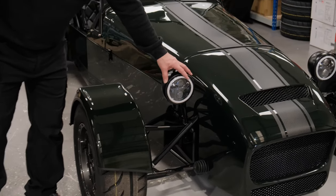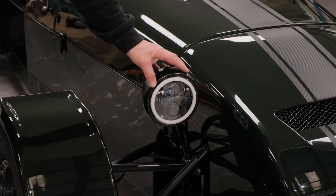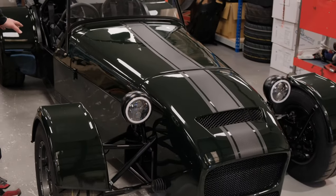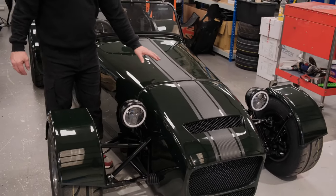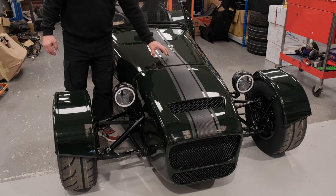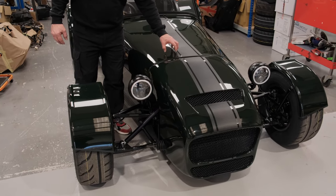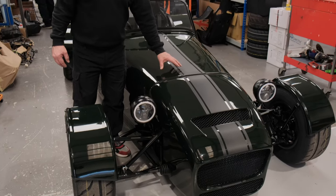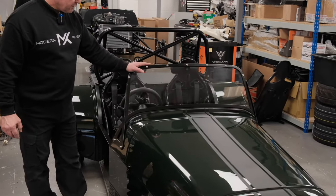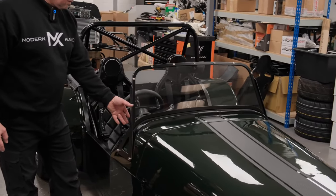We've now gone in with a change — we may go back the other way — but it's got the LED headlights. It's got the cup nose on it and we've got a flat bonnet, which is quite nice because it does fit with a Mazda engine, we can fit the flat bonnet. Not sure about the VVT. If you've got VVT variant, because that sticks up in about here, then you do have to run the scoop unfortunately. We're starting to fit the weather pack on here, so we've got the windscreen going on, the scuttle, and we will have some mirrors.